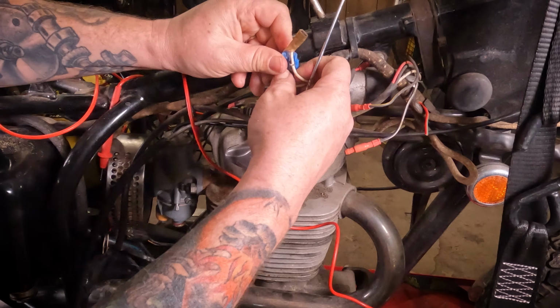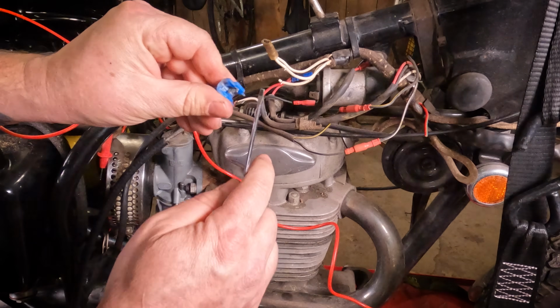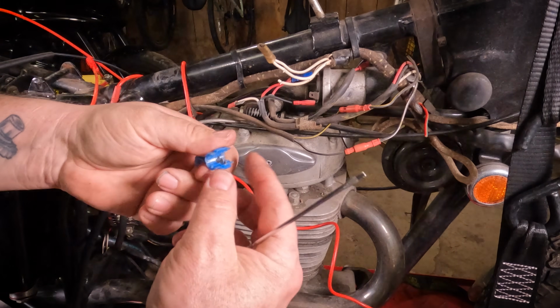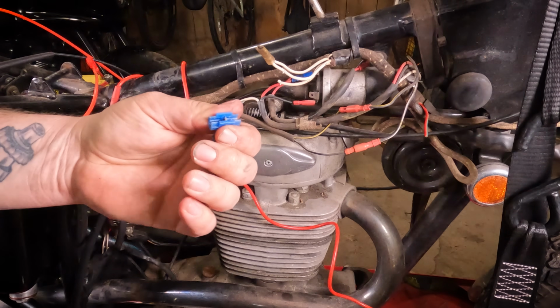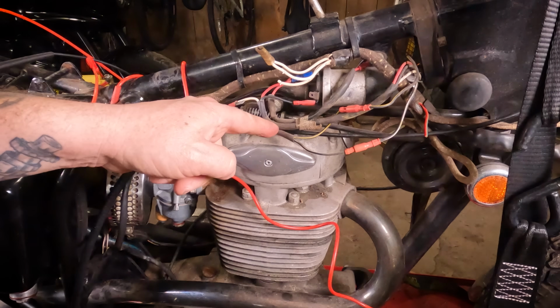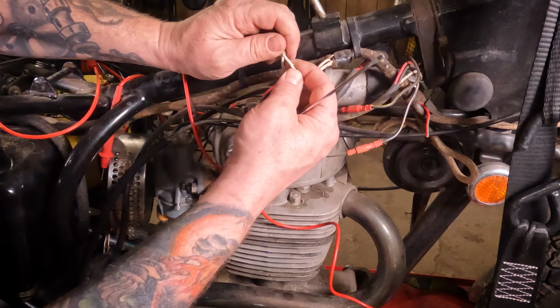Let's take a look here. So the wire would go down in there. So we have two knife edges instead of one. Either way, that's not a great conductor, and you've already cut the wire in half. Plus, you're relying on this tension of some old plastic that is right over top of a cylinder head that gets approximately 260 degrees. That's a recipe for disaster.